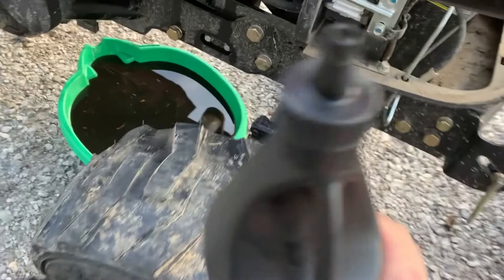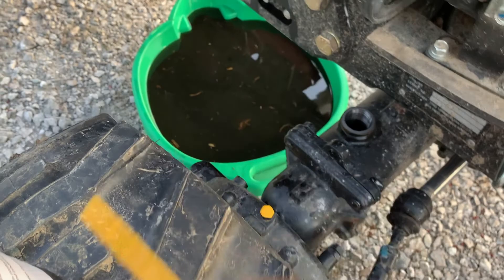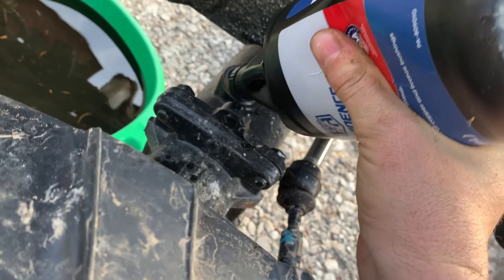This is where you put the gear oil into the front end axle — just take that off. This cap isn't just the cap, it's also the dipstick. Make sure you don't lose the gasket like everything else. I can't stress it enough. Just get her close — in we go. It says three to four of these, so we'll go three, and I'll catch you guys back up when I'm done with all that.